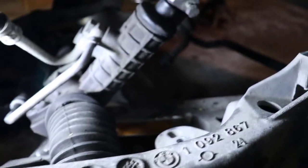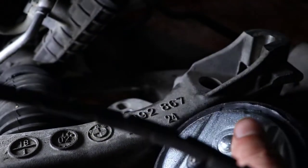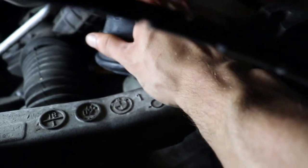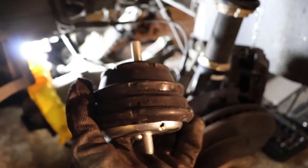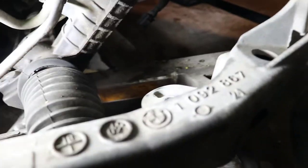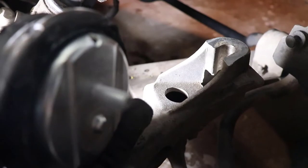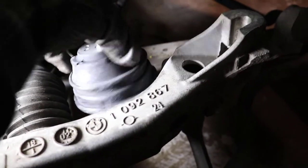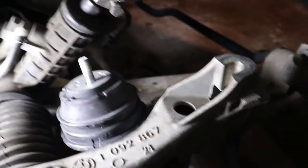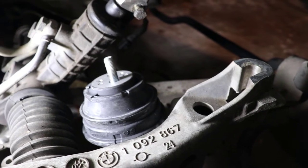Now it's the next day. The oil pan is dry. I'm about to lay a little bit of Permatex on each corner just to seal it off. As I was cleaning the underside of the engine where this is going to mount up, I found that there was silicone put on there from the factory. Nonetheless, I'm going to put it on each corner and then stick it underneath there and start hand tightening some of the bolts so it can hold itself. On the driver's side, there's the mounting position — there's a little dimple you line up with the hole, it drops down in there like that, and as we lift the frame up it should go into the hole on that side. Then you can bolt it down on the passenger side as well.